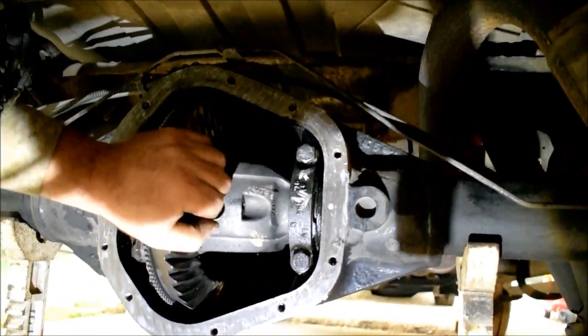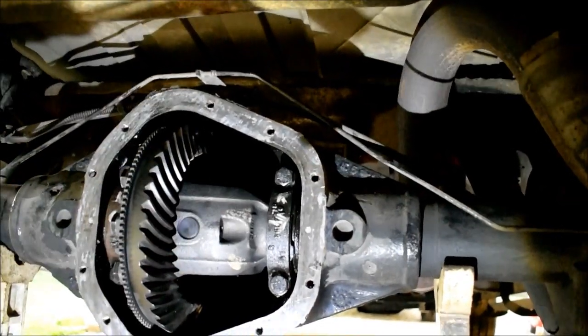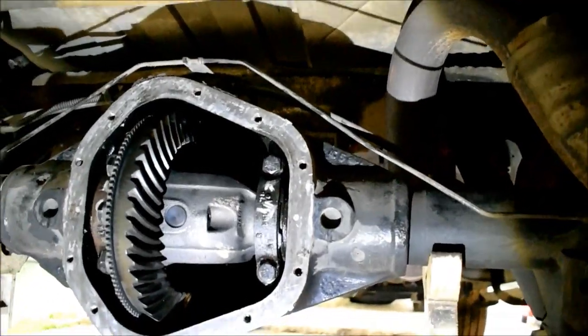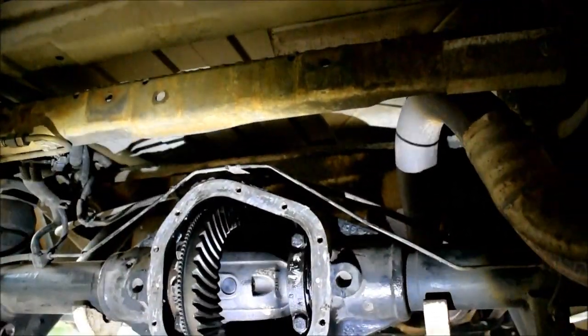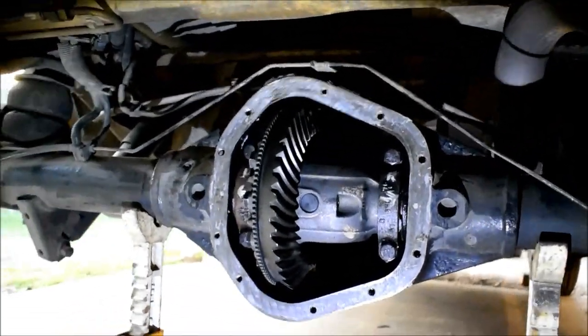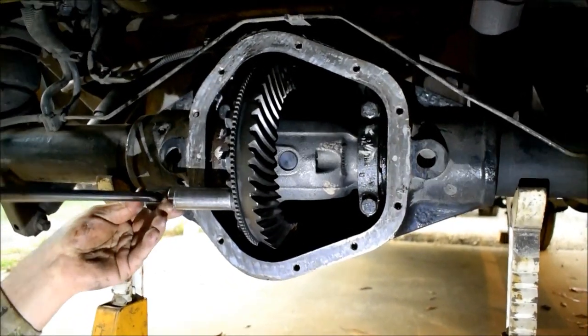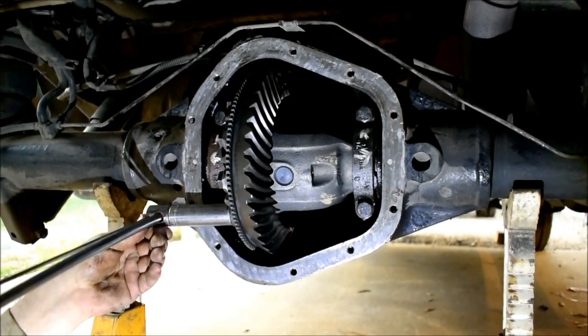Well, we're about at 100. Between 95 and 100. Will that put extra drag on the bearings or no? Dude, no, it's not going to crush those races. No way. Now, here you go. Here's your 13/16. How about if we see what we really got? All I can tell is up to 100 because this cheesy torque wrench only goes up to 100. It'll stop right there.